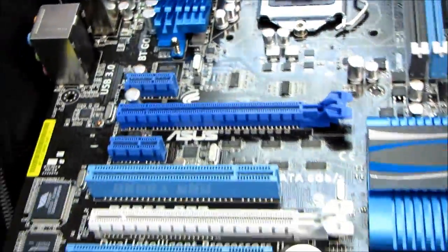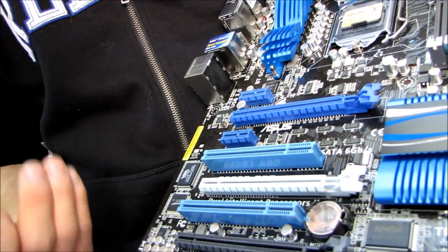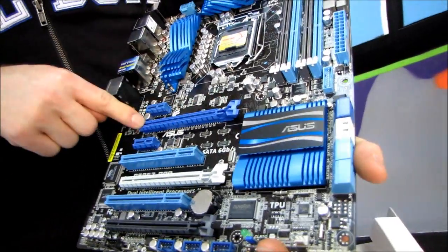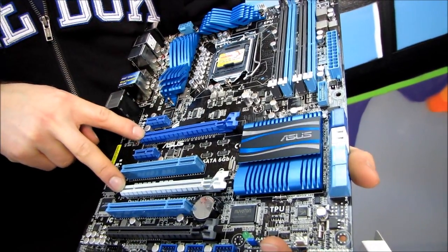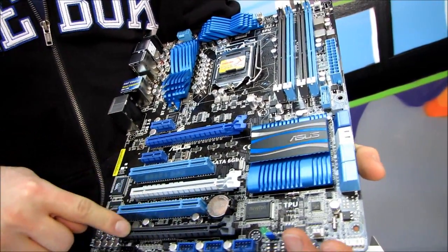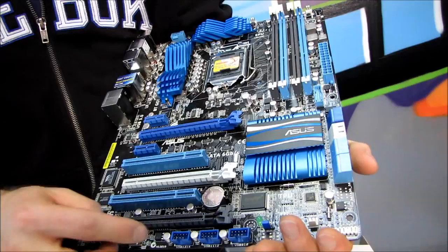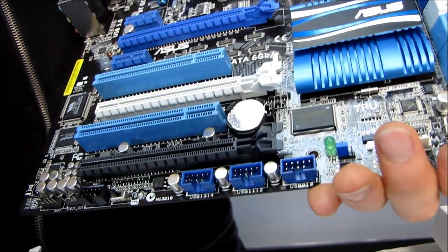PCI Express slot layout — pretty happy with this one. You can see it has seven total expansion slots, which I always appreciate, because six, especially if you're running dual graphics, simply isn't enough in some cases. There are three PCIe 16x slots, although please note only two are going to run at anything resembling 16x. If you're running a single graphics card, you want to put it in the first slot for full 16x operation. If you're running two — and this is a limitation of the P67 chipset unless you're adding additional chips such as an NF200 — these are going to run at 8x and 8x. If you install a third, they will run at 8x, 8x, and 4x. Bear in mind, this 4x is going to be coming not off the PCIe lanes on the CPU directly, but rather through the south bridge — an archaic term, but that's what I'll call it — so it's not ideal for graphics card use, although it's fine for something like a RAID controller or a really high-end network card.